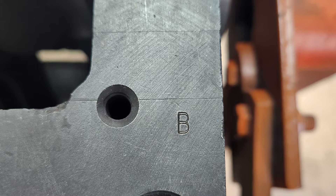Since the measurements are taken off the oil pan rail, you want to make sure it's really clean. I have a question for all you Mopar fanatics out there — when I was cleaning it, I found a stamping on the rear of the block by the rear main seal. It's a 'B,' a hand stamp — you can tell because it was double-tapped — and I couldn't find out what the B would mean on the oil pan rail near the rear main seal, just past the last bolt hole. So if you know, leave a comment below.